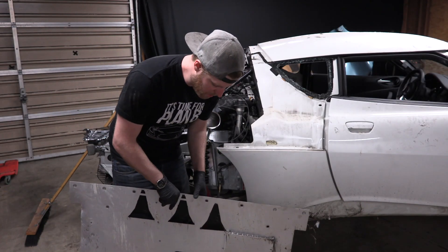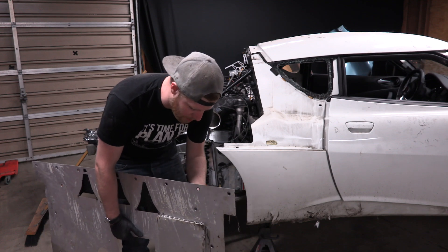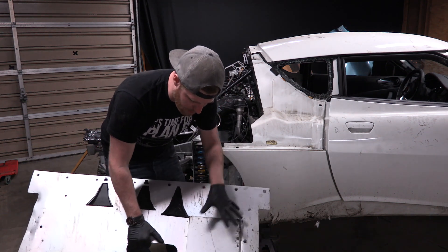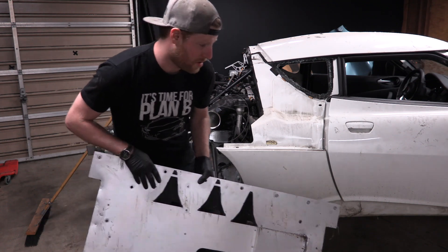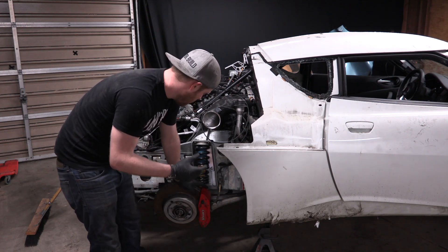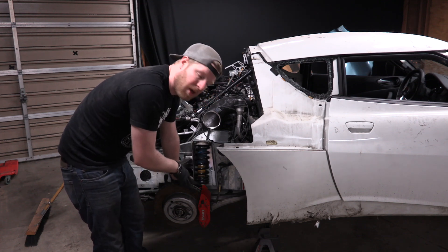So it's kind of a good news, bad news situation. This piece came off from underneath the car — it covers up the bottom of the engine components. These holes are where some exhaust pipes poke out; this part scoops in some air. This part's damaged, may have been from the wreck or from a pothole in California — I can verify those do exist. It's just riveted aluminum so it'll be easy to fix. We pulled this off to gain access to the engine area, and I got a much better view of the mounting points and where the lower control arm mounts to the subframe. The bad news is that the lower control arm on this side is a lot closer to the chassis than on the other side — that means one of the mounting points on this is bent.